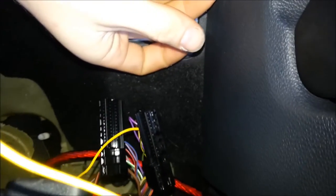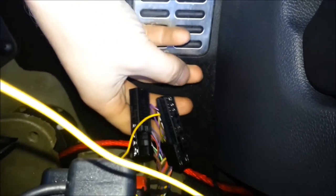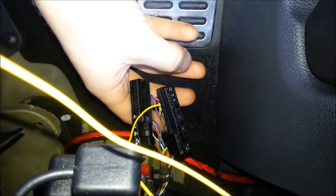After that we're going to pull the brown connector, unhook it and take it out of the way so we can do the exact same thing — split it and do some other steps. One correction: on that black connector where I put the yellow wire into pin 19, you actually need to take the yellow wire with the black tape and put that into pin 17.